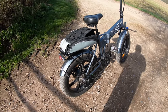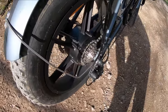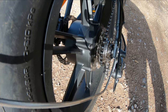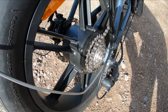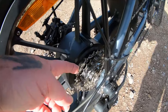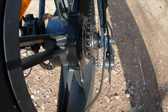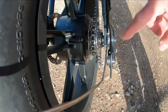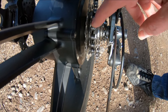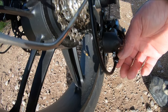I've had a few people ask me about chain noise and derailleur noise. It's really when the chain isn't centered on the cog that you'll get that clicking sound. There are plenty of videos that show you how to set it up properly — adjusting the high and low so it doesn't fall off the top cog or into the frame. For a quick fix, look at the index and put it on the middle cog. See how it sits on the sprocket — it should obviously be in the middle. If it's either one way or the other, you can adjust this barrel screw here.